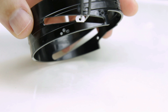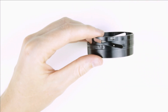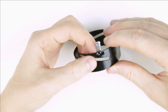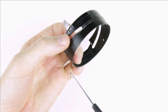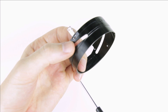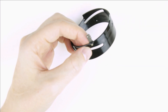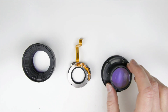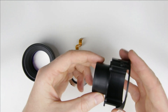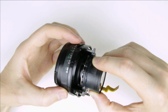Let's test if the plastic leader slides freely in its place. Now put back the small metal part. Sometimes the ring gets stuck on the plastic lens body, so a little bit should be rasped. This is the part which should be rasped. The outer part of this lens body should be in line with the lower part which is screwed onto it.